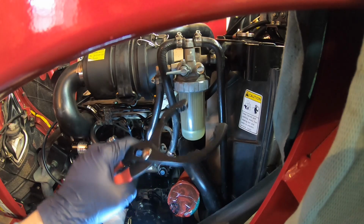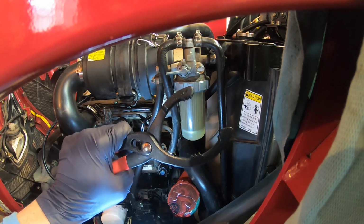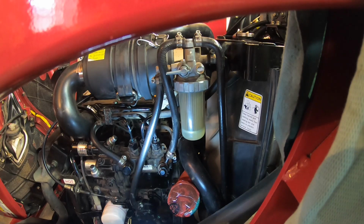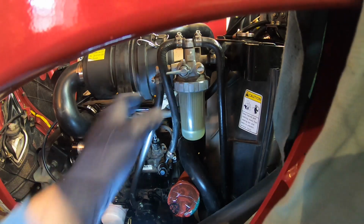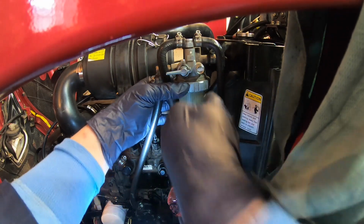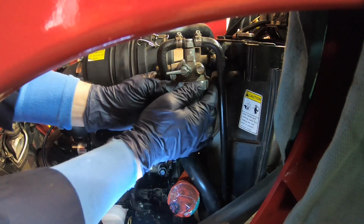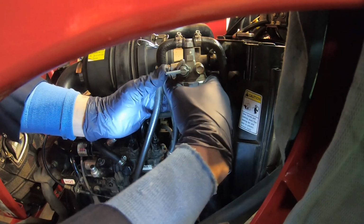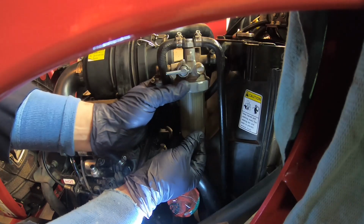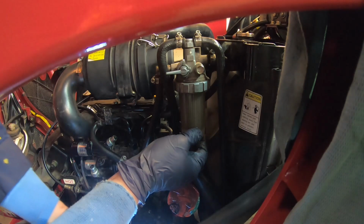This is only to be hand tight. However, the vibration of the tractor makes it tighter. So that's why I broke the torque on it. So yeah. Now what I'm going to do, there's a rag in here that protects me against any. So what I'm going to do is basically just unscrew it like this and gently remove it like that. Whoop.